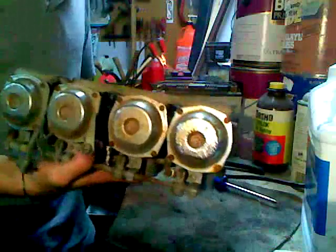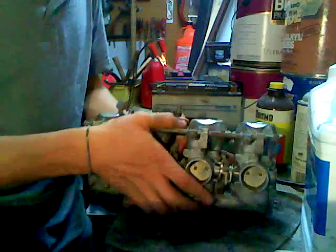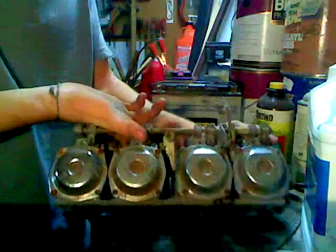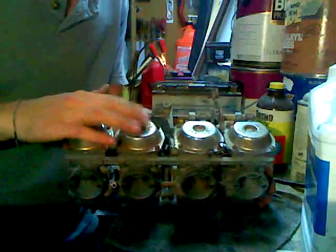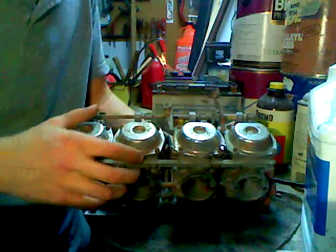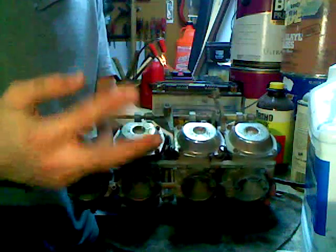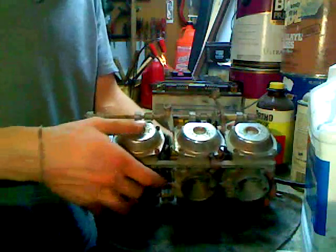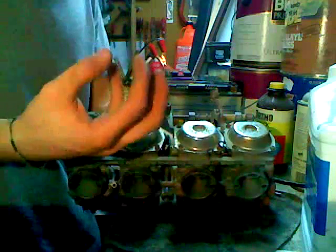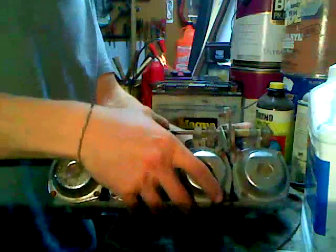The main jet needles — they're not adjustable. Well, they are adjustable, but you typically won't have to bother with them. These heads come right off, and then you'll see there's a rubber diaphragm. That's what allows the second throttle plates — the vacuum cylinders — to actually move up. The rubber diaphragm causes a suction that allows it to move up and down.